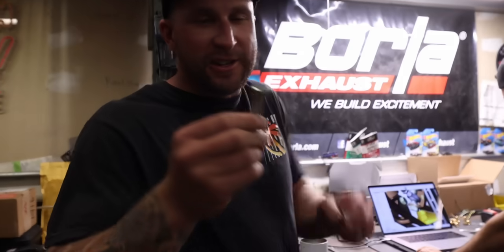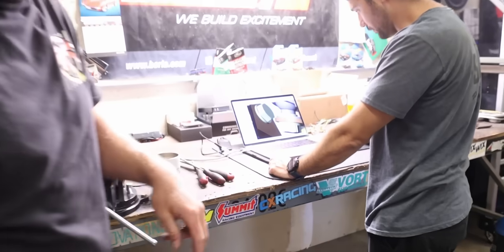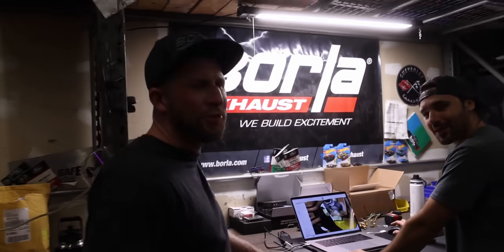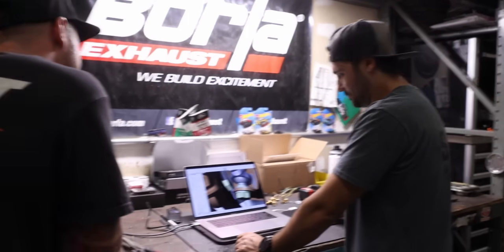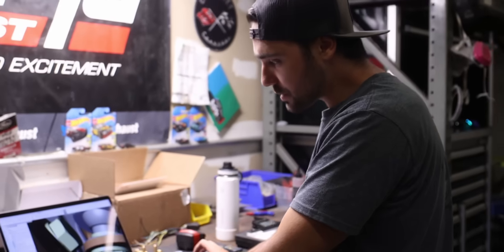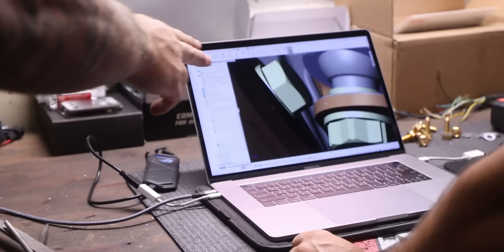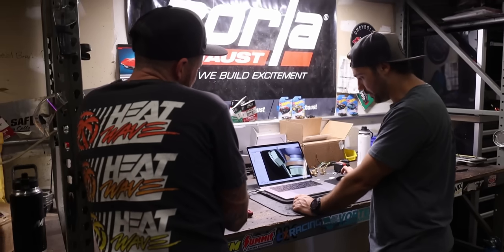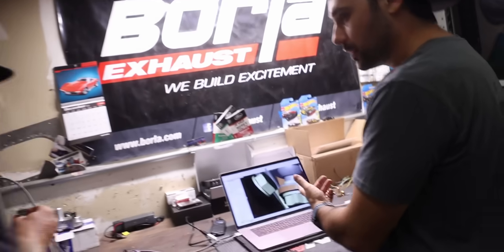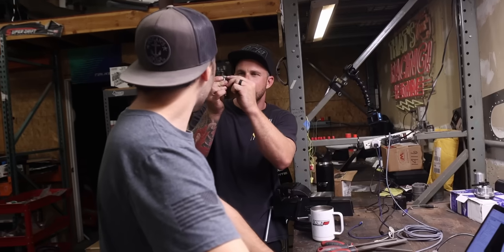Right now Chris and I are seeing if we need to turn down the head of this bolt because the knuckle tie rod gets very close to the head of the shock bolt. We're checking if we're actually going to need to turn it down. Normally I'm like 'let's just put it together and we'll see,' but this guy says 'no, let's look at the computer.' This is full droop at 65 degrees angle — rare that you'll be in that scenario. As it bumps it pulls away. This thing can hold 65 degrees angle throughout all the travel, and it gets better. I don't think we should cut it — but he's skimming a little bit of that. Because everything's going to flex under load, I'll just take down that tapered amount. Let's just do that.